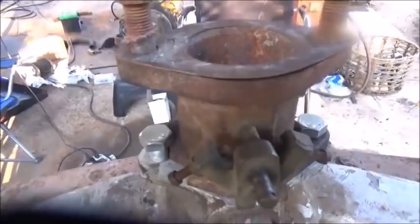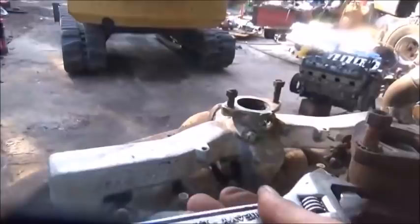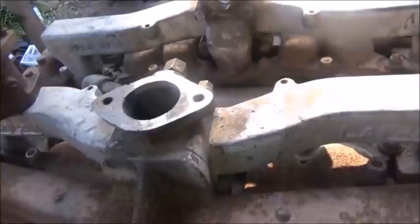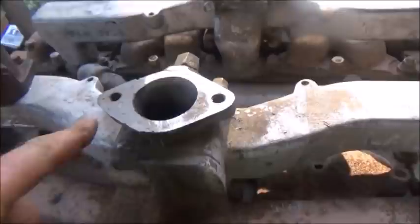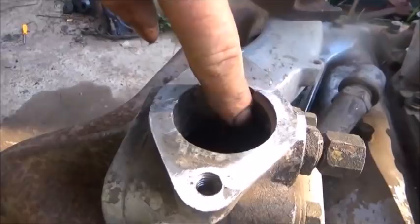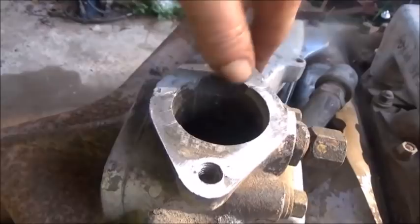As you can see, the adapter itself is broke right here, but that's not a problem. We're just starting with it. Let me take this thing off — like I said, we've got to put a gasket on it anyway. I'll show you what we're dealing with here. Drilled it and tapped it with a 7/16ths. It tapped pretty good. It's actually feeling really good and hard — it's not spongy like it was. This will work just fine for what we're doing, just to start this thing up. It filled in good, and it seems like it's bonding to that rough break from the manifold.